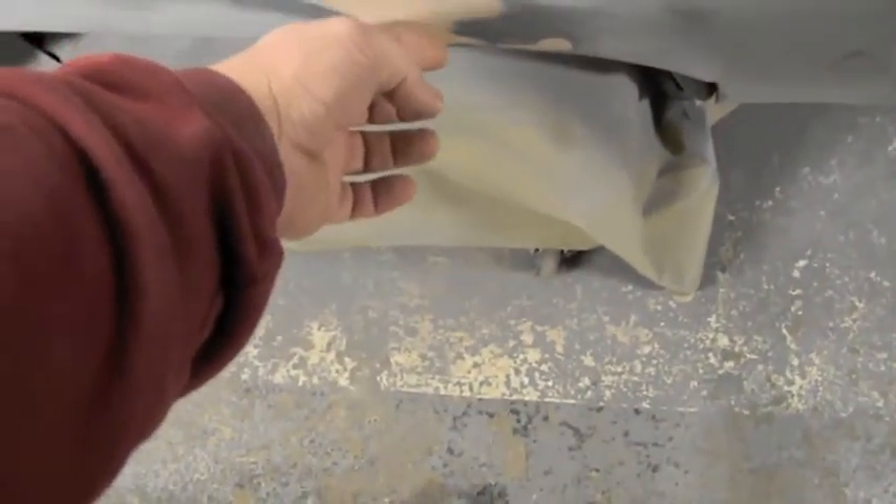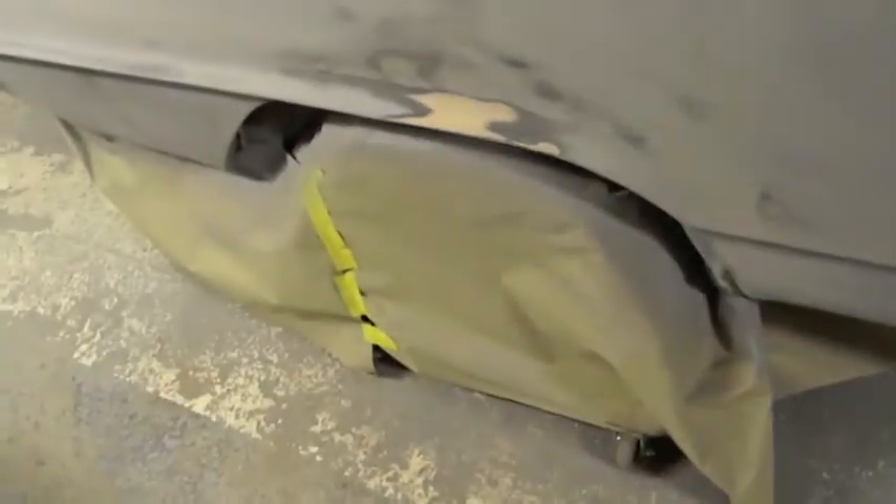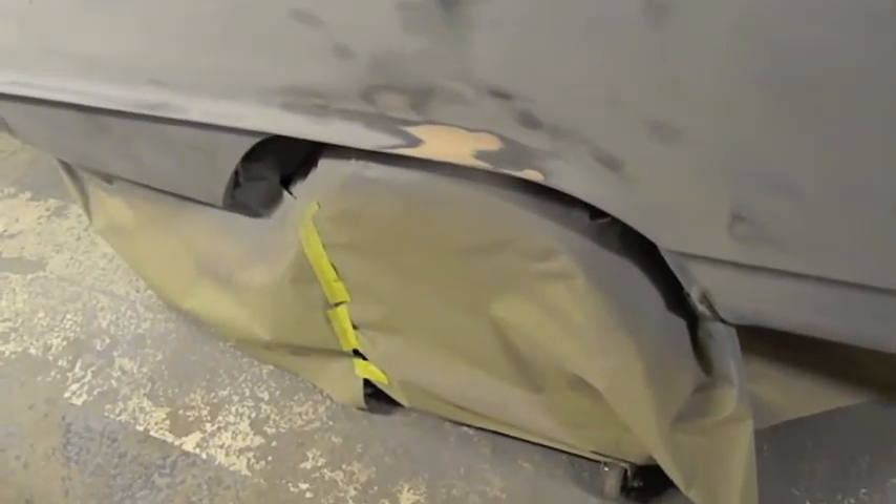It's Monday afternoon. Started blocking and took care of the area I knew was a problem from when I did those wells. It seemed this curve was a little higher than everywhere else — you could see it when looking down. I noticed it in the gray, not the black. So I sat there with a long board and just reshaped it to match the rest. It feels good now. I'll have to put a couple coats of high build on there and check it out.